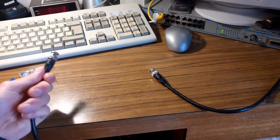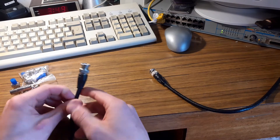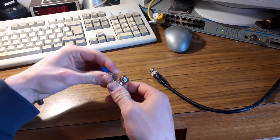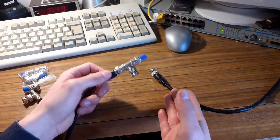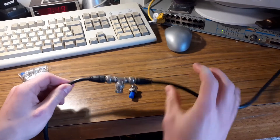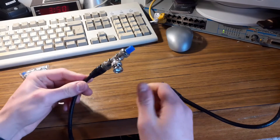There are a couple of ways you can set this up. At each end of the network — meaning a computer with nothing connected to one side — you just take your T-junction and a terminator, connect your BNC connector to one end and a terminator to the other, then plug it into the computer. Most network cards will automatically differentiate between whether it's terminated or non-terminated — whether it's in a chain or at the end of a network.